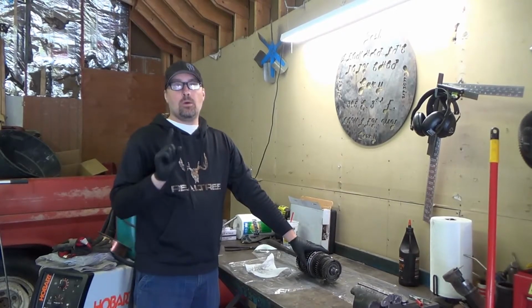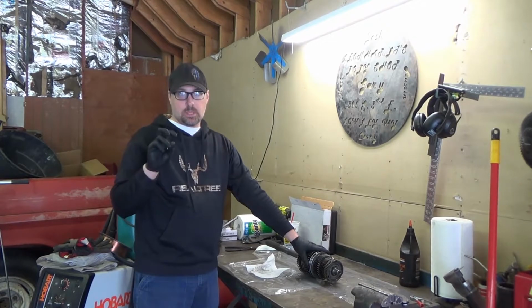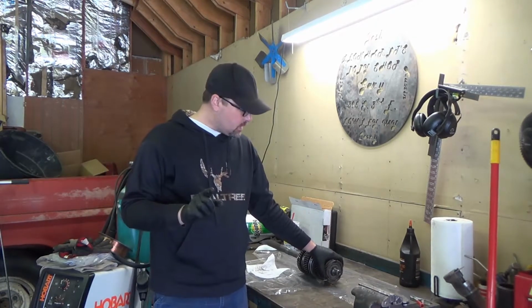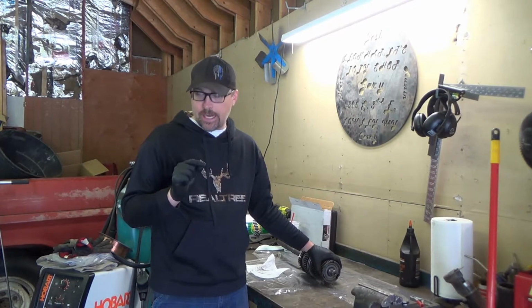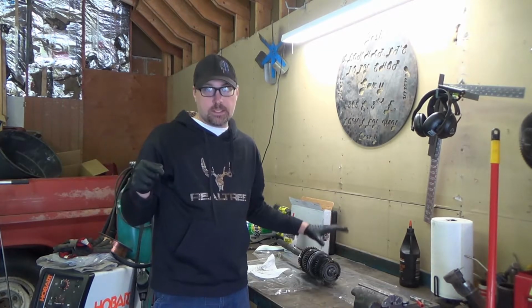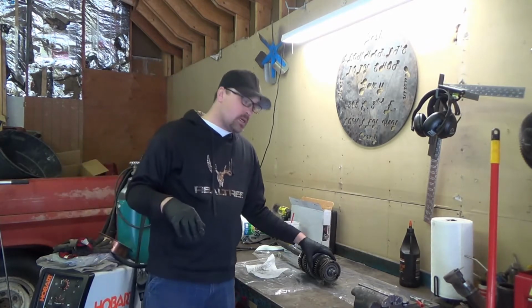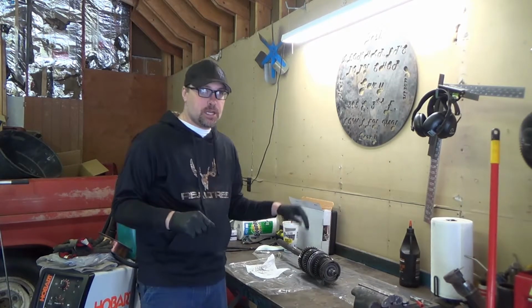Okay, now we are going to get to what has taken so long with this simple clutch job. I don't remember if I said it or not in the earlier video, but the 1-2 shift was getting a little bit crunchy, and I had a feeling it was a little bit more than just the clutch. So before I pulled the tranny out, I drained the fluid. This is a Tremec TR3650 in our 01 Mustang GT, and there was definitely some brass shavings in there.